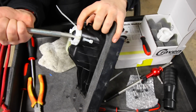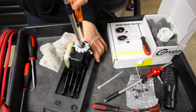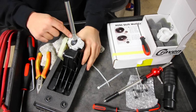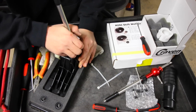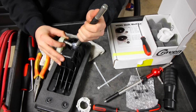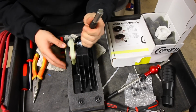And by doing that, see how the entire thing came out? Well, once you have it at this point, grab a set of pliers and you can pull the entire white piece up, if you can get a grip on it. Like that. Then from here, this little white part we can pull up and slide it off of the ball from the shifter. We'll slide that out. And then from here, we should be able to maneuver it and get the shifter mechanism out. Now, I'm kind of figuring out how to do this stuff all on the fly.